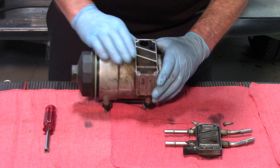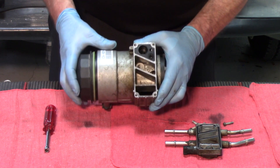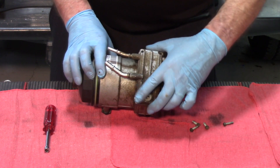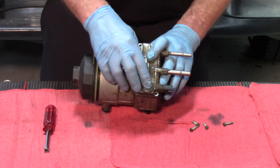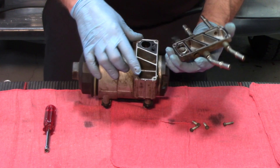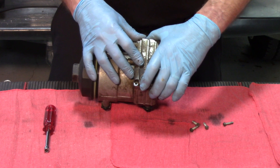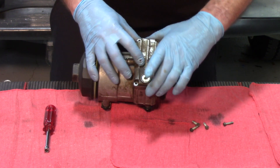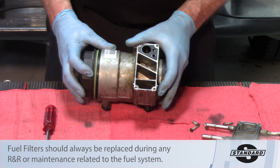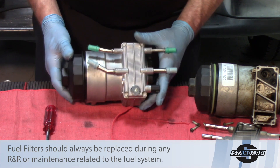This is not an uncommon occurrence. As you can see, there is a lot of build-up internally — this is not a good piece to put back on the vehicle. These come equipped with a drain plug. Ford recommends draining it on a periodic basis to get water out of the system, because water is what results in this type of rust build-up. If you're not draining them periodically, you're definitely going to have build-up issues. In this case, this one is no longer a viable component and should be discarded and replaced with a complete new assembly, which is readily available.